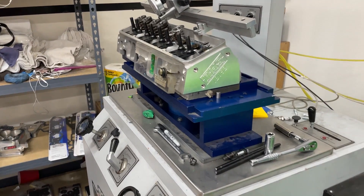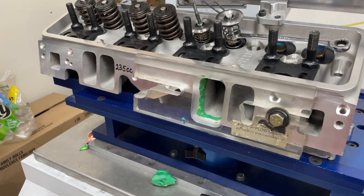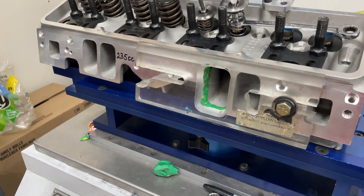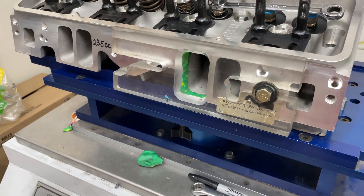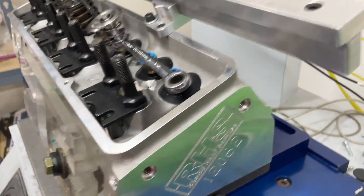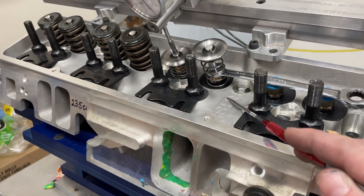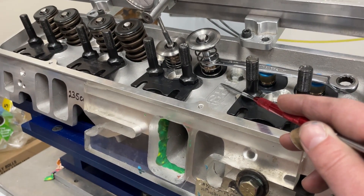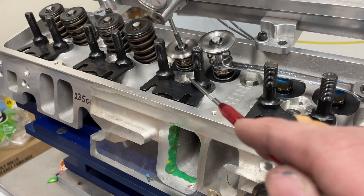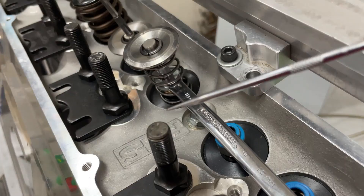Here's the RHS head on the bench. I flowed it on a 4.155 bore board because it's a 235 CC head — chances are you're probably going to put it on a 406, 421, or 434, not on a 388. No exhaust pipe attached and flowed here. Let me point out one more thing: the intake valve has no back cut, which makes the low lift flow numbers even worse. Keep that in mind — there's no back cut on the exhaust either, but we typically don't put one on there. The other thing I noticed is the rocker arm studs are ARP, which is good.